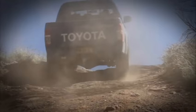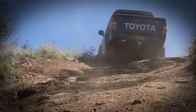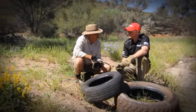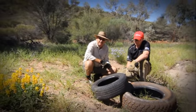The problem with that is it gets more brittle as it gets older. The tyre has to act like a bit of a spring, and the flexibility that rubber is required for is actually sacrificed as the tyre gets older. So tyres are not like wine - don't store them.